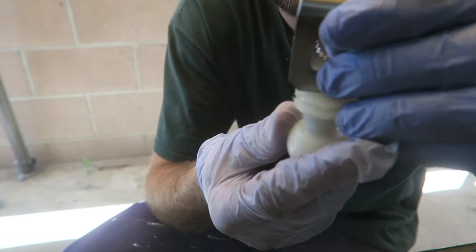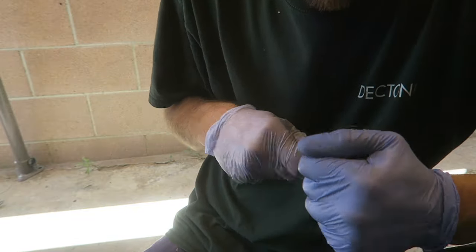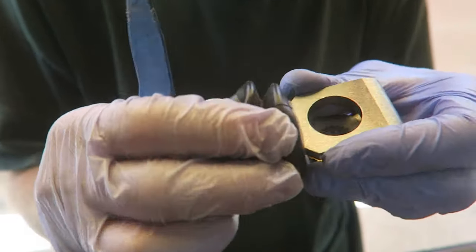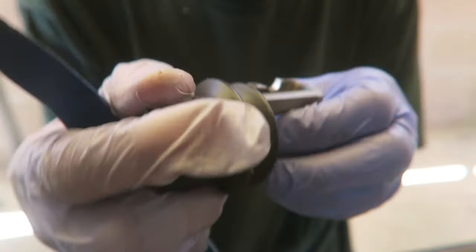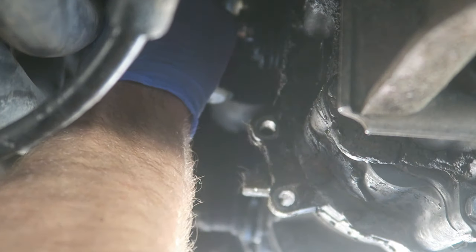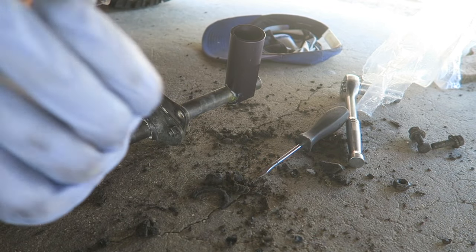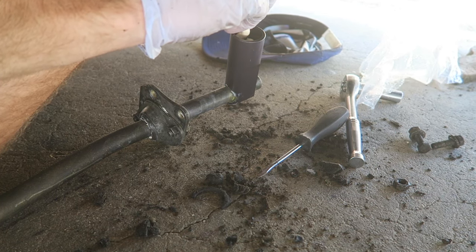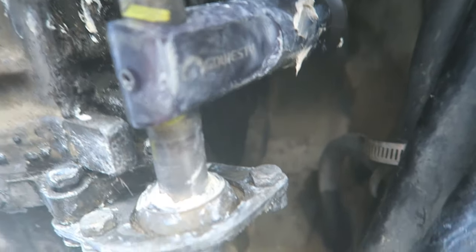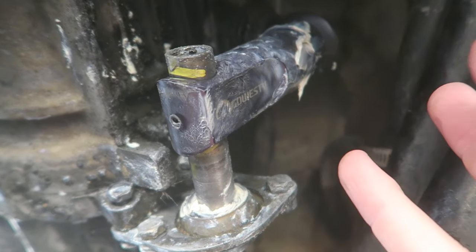Here's the piece that bolts onto the transmission. This is what drops into the shifter elbow or shifter selector, whatever it's called. This is the boot for it — I'm going to go ahead and try to slide this on. I just used this plastic trim tool and slid it around the top ring, which is actually pretty tight to get around. It's on there now. New one's going on. I got a new spacer and a new bolt as well — it can only go on one way. I'm going to go ahead and fill this cup up with grease. A bunch is going to ooze out but I'll just wipe off the excess. And there it is all installed. I had the thing so tightly packed with grease it was hard to push the ball into it, so I removed a little bit and it slid in no problem.